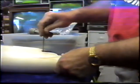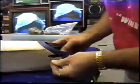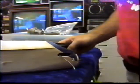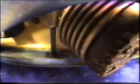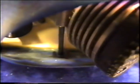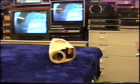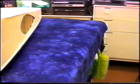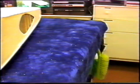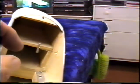Now, I want to shove these down into the exhaust holes, and that'll give me a little mark out on the other side where I have to drill the holes. Okay, that gives me a little mark. I just put that on with a Sharpie marker, and now I can drill the holes for the muffler bolts. And once I have that little detent, I can just shove a pin in. I like to do this with a Dremel bit. I don't like to do this with a drill, because what happens with a drill, it'll catch and go, and you have a mess on your hands. A Dremel tool is a lot nicer.